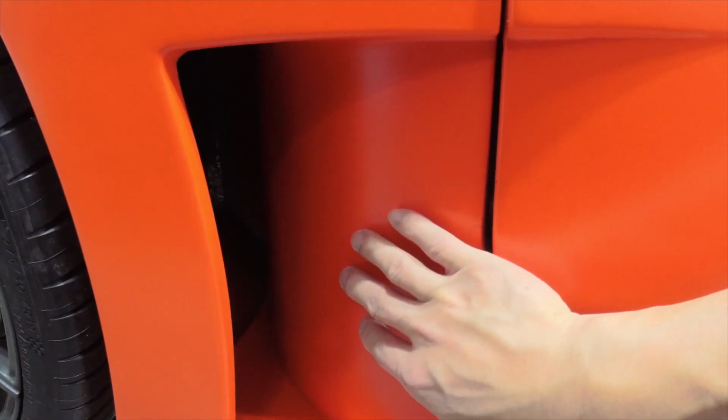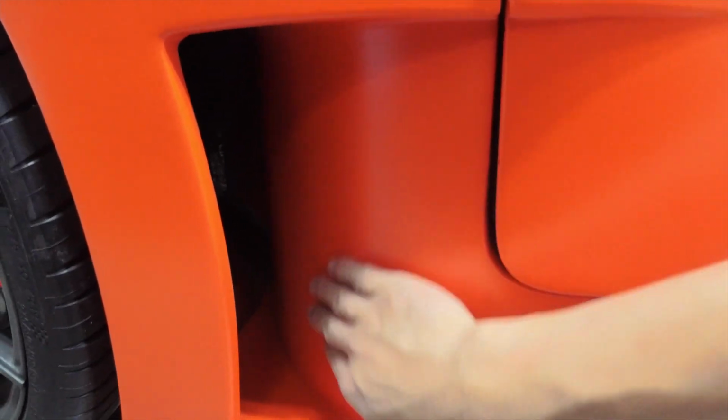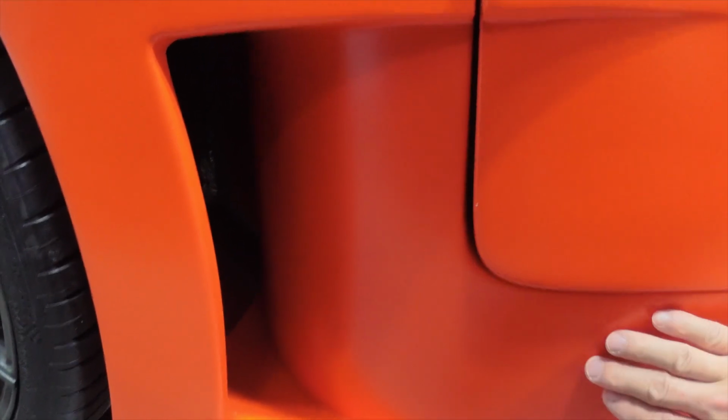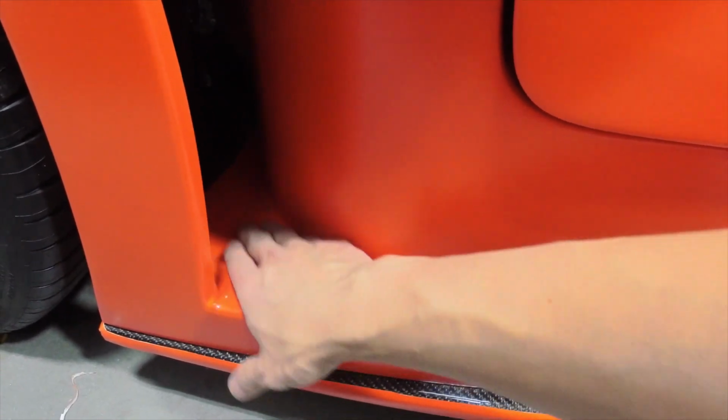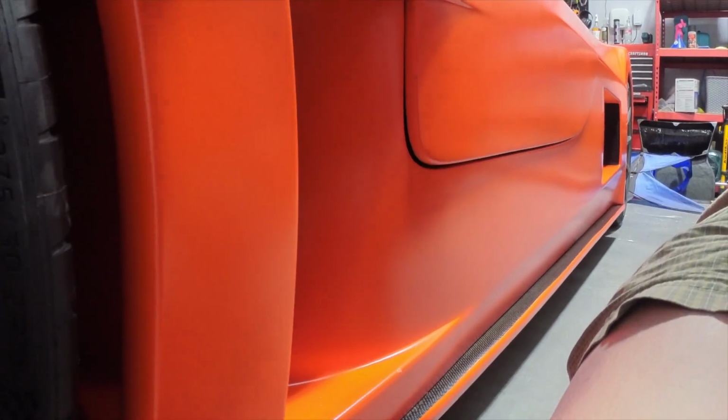The issue with adding the clear PPF is that the clear PPF will absorb the dyes from the PDS that you shoot underneath it, and visually you can see a pretty stark difference between the body panel and the PPF, because the PPF draws so much of the dye from the PDS up into it. It becomes a darker, richer color than the body panel, and so it's very obvious that you're running a clear strip of PPF in there. Now we do the same thing in this lower portion here as well. Piece of PPF here, piece of PPF here, and even along the interior portion, or the forward-facing portion of this part of the spider here, I'd put a strip of PPF there too. So I'm not going to do that this time around.